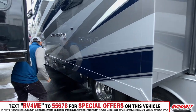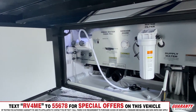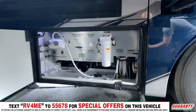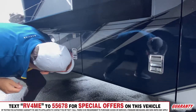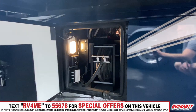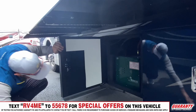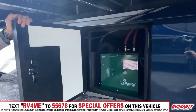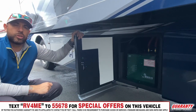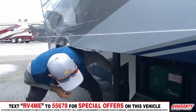Panning through, we're going to check out some of these cubby doors. This is your wet bay. The wet bay has its own hose reel line already on the coach, so you just plug it at your campsite and reel it back in. Your shore power — very easy and accessible. Once you plug it in and need to retract it back, it has a button to hold: it's an electric reel cord. And the hydronic heating for the coach — the Oasis Hydronic Heating Module heats your coach furnace with no propane on board. This bad boy is electrically driven and uses droplets of your diesel fuel to power the igniter. You can use this for your heat on board and specifically for your water — get that water instantaneously hot.